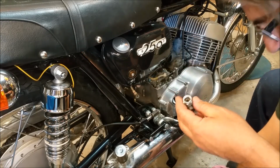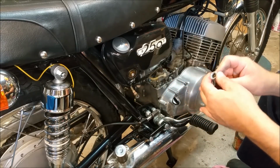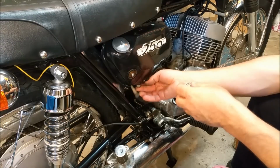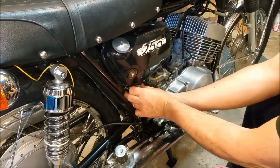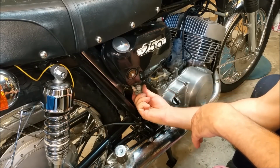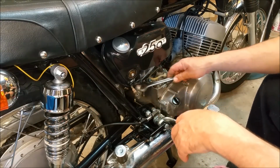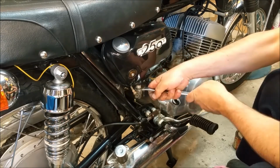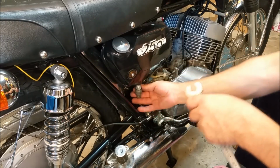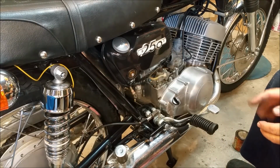There's your O-ring sitting in the top, and it's an old one, but it's still supple, so I'm hoping it works. If it doesn't work, well, it's just going to be suck eggs, basically. I have to get another one. And of course, there's a little filter that goes up in there, and then we've got this guy, which screws on with a conventional thread, and a banjo fitting that basically goes into there. So I don't know how this is going to go without leaking. It could leak. It most likely will leak. That's as much joy as we're going to get out of that guy. And we might just have to put the banjo fitting on that side. It's pretty confusing though, if you haven't pulled it apart. But I want to have this full of oil.